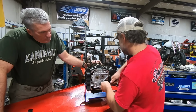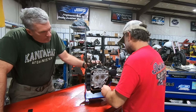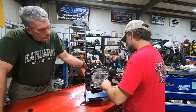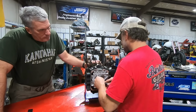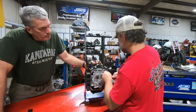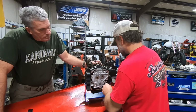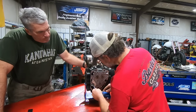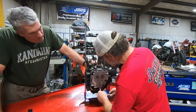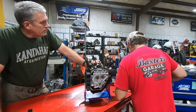Another issue that I found very common around that era: there was a vacuum port on top of the throttle bodies, and it was not at all unusual for the little rubber cap on that vacuum port to fall off. And engines would run hot. The stock fuel injection system would kind of compensate for it, and they just ran lean, and of course would then run crazy hot. People chasing their tail looking for that, just missing a vacuum cap. So that could have been what happened.